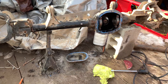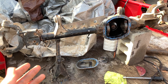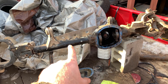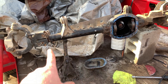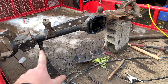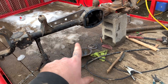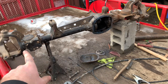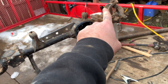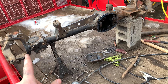Basically this is pretty self-explanatory — you don't really need a step-by-step guide. We already got the lunchbox locker in there, we're just gusseting everything. I put little tack welds on the sleeve so it holds in case it gets knocked around when I'm not here. We got all the brackets tack welded on, I started welding this a little bit to make it stronger while rolling it over, tacking the gussets on. We got the lower control arm mounts plated — so we're going to go ahead and weld all these brackets up, and then we'll start on the C gussets.